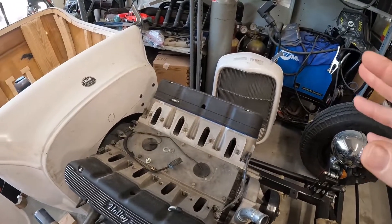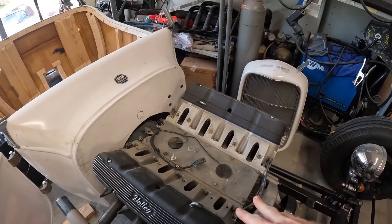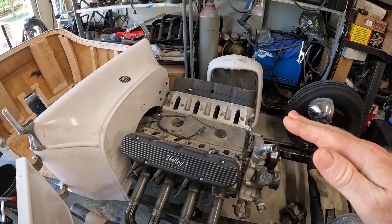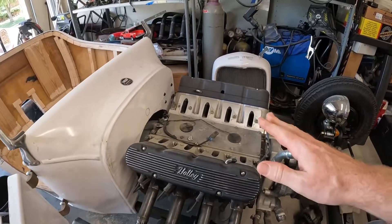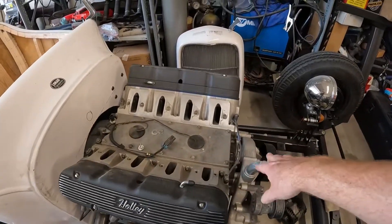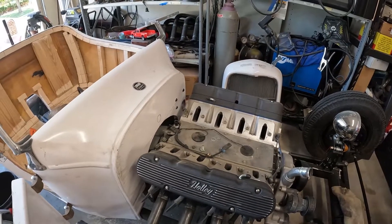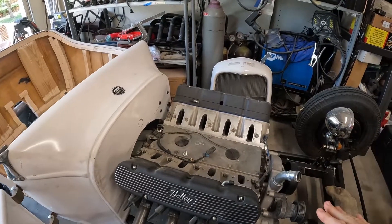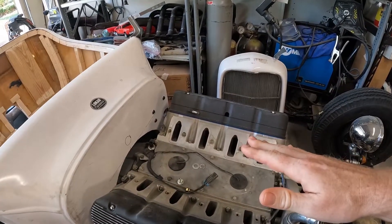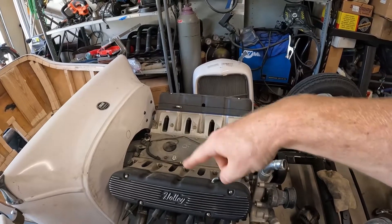So the next question is: do you need two hooked up or all four hooked up? Really simply, it depends on the engine angle. This engine right here — because I have it up on jack stands — the front of the engine is actually lower than the rear. But when it's sitting on all four tires it's actually level. So if an engine's level or tilted forward like this, you'd really want all four hooked up.